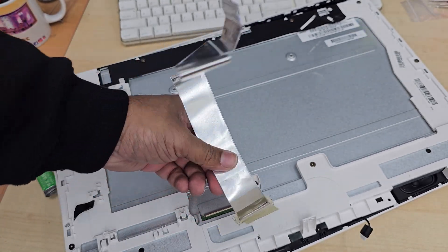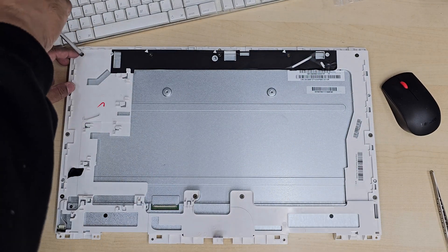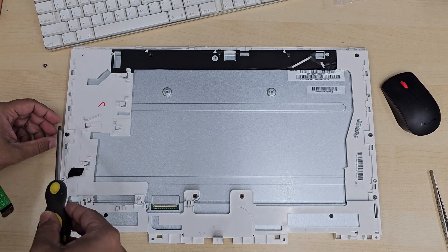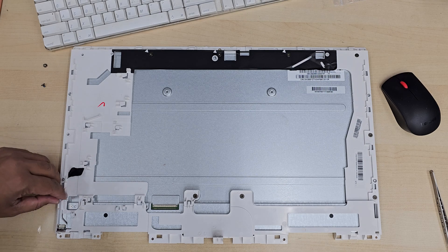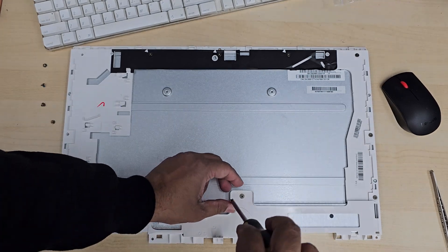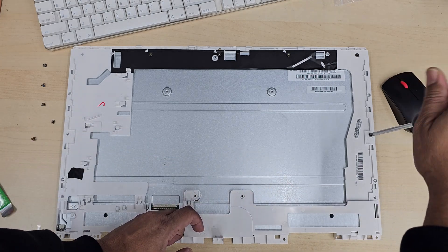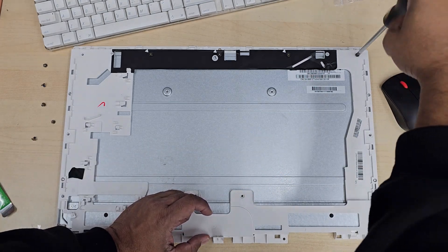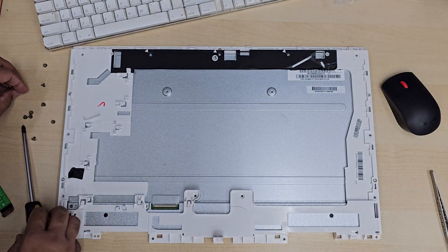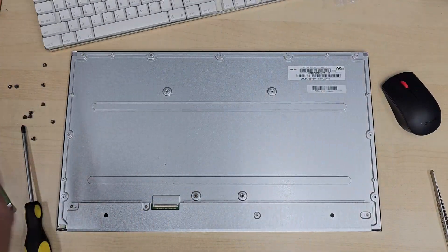As you can see there are two push anchors — not buttons, they're a kind of anchor. When you push it, it unlocks, same as a belt buckle. Now we're going to remove all the screws from here to take out this actual frame, and we're going to put it back onto the new replacement screen. All of them are the same size so you don't need to worry — just keep them together, there's nothing to get wrong. This is the actual frame that we have taken out now.